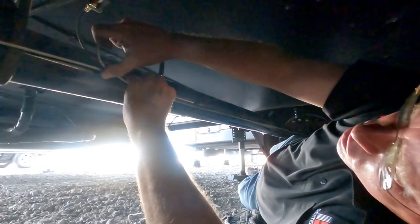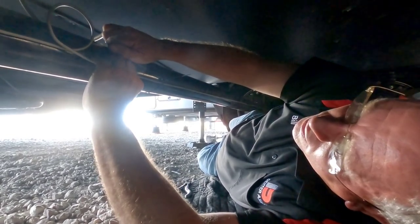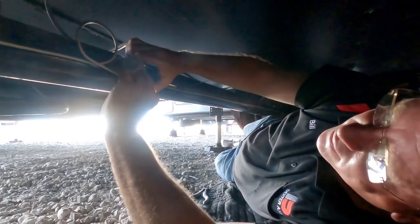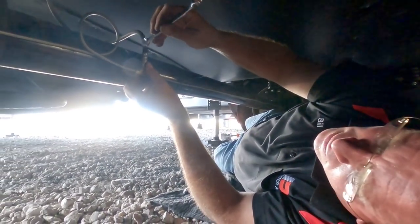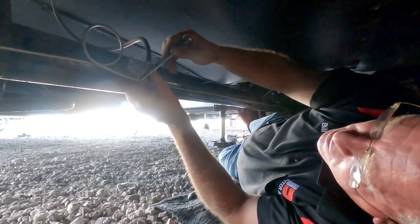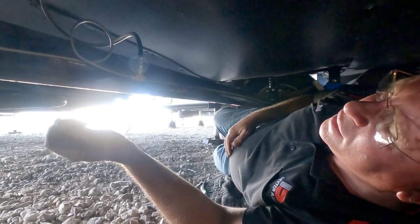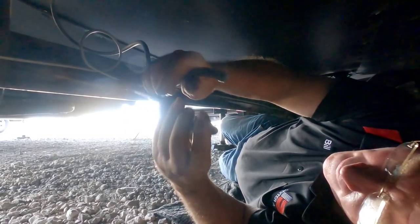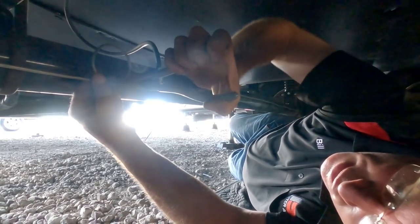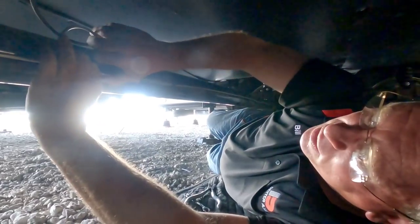What we're doing is making a shortening loop in this brake line, because with prefabricated brake lines for this exact configuration, we needed to bend a slight loop into the line to make the lengths of the rigid line come out properly. An expansion loop like that also helps with some flexure in the system. We've taken up the extra line length with this loop and will secure the line going across the back of this axle. In production you would have exact cuts, but doing it out in the field, you want to use an existing line and add an expansion loop rather than reflaring one.